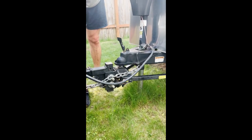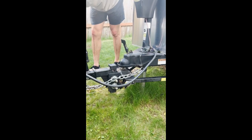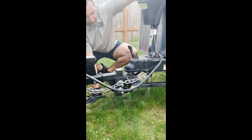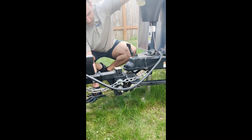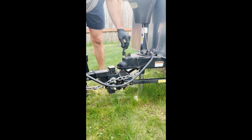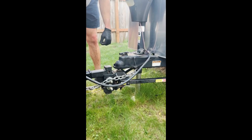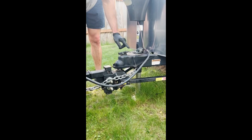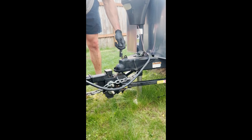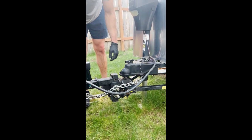We're going to continue to return. We're going to wait for the foot to release just off the ground. Now it's just off the ground, so the trailer is fully resting on the hitch. To test whether or not it's sitting properly on the ball, we're going to push down and put this handle back. The fact that it was able to sit properly like this means that it's on correctly, but we'll also do additional tests. Push down on it first and then push back so that it can sit fully.